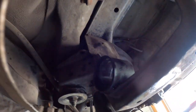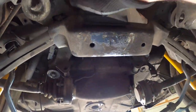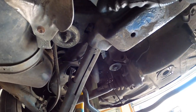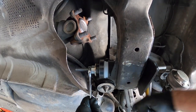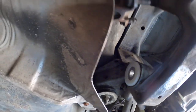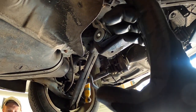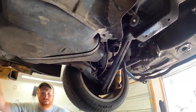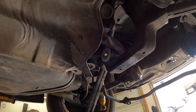The old bushing is pressed out and the new bushing is a Delrin bushing that needs to be pushed in. It's basically a really, really close proximity fit — really good. I think it's going to work out perfectly, but this guy has to get pushed in, and we're going to use the same puller to get it right into place. I wanted to make sure I pressed the bushing with the insert at the same time, because it was such a close fit that the outer diameter will end up shrinking to conform to its mate. And now I know that was the right choice because it's pretty much in there. Front bushing's ready — let's do the two rear bushings.